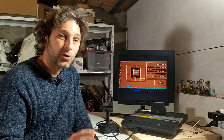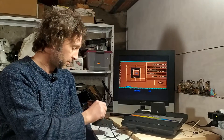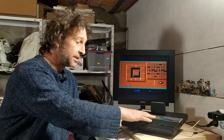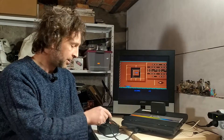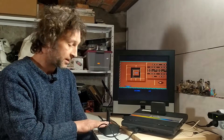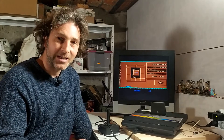I went and had a look at the Jinx manual, and it spoke of fire buttons A and B doing two completely different things — but this controller doesn't have fire buttons A and B. Digging around further, I found that the Atari 7800 was sold with a controller that had two fire buttons, and they're wired up in a completely different manner than the fire button on the Atari 2600 controller. So with a 2600 controller, an awful lot of 7800 games just won't work properly.